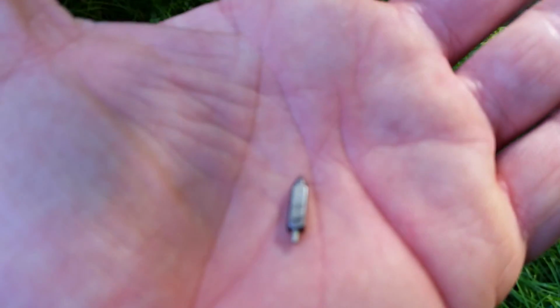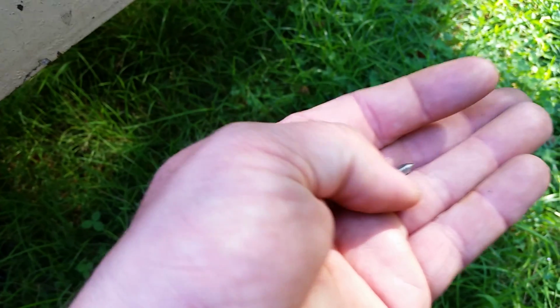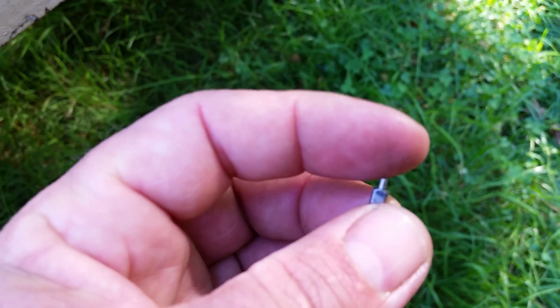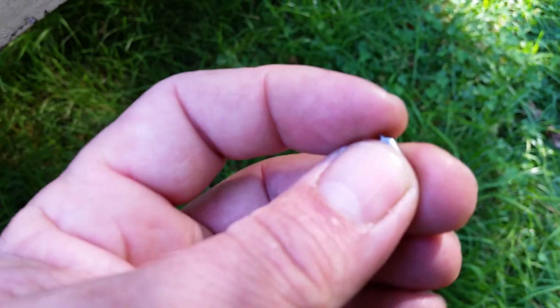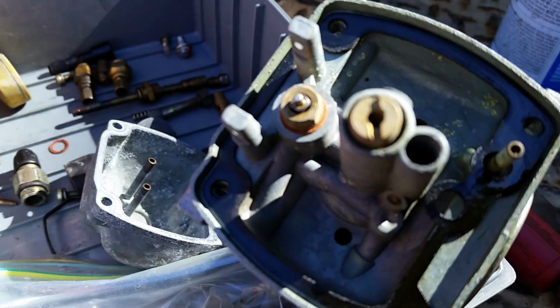If your carburetor needle, if I can get that in my hand here. Okay, this is dirty, but the camera will not focus in this bright light. On the end of it has the needle right there, the valve, and then this end right here is the spring tension for your float. Okay. So after you get that needle and seat all cleaned up and there's fuel flowing through it, you put your needle back in like so.